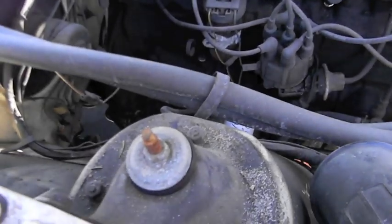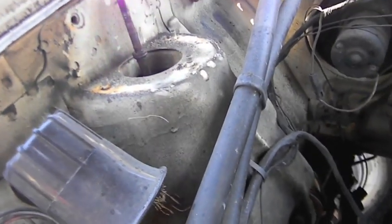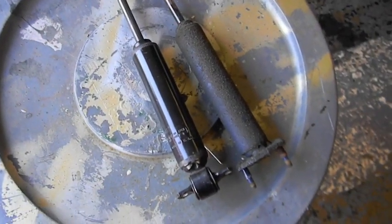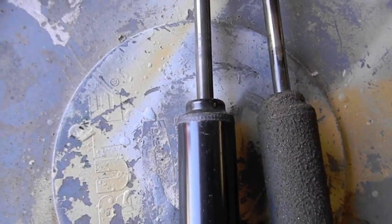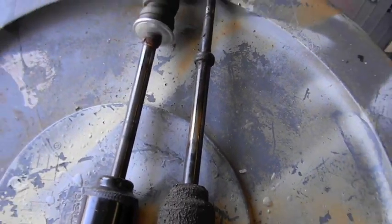It's held on the top, so let's get it out and see what we got. You can see on this side you've got the mount for the shock. I took it off — that was something they added in 1970. In 1968 it was flat, there was a small spring, and the shock actually went from the frame to the lower control arm. After that they put the shock up top and added that mount. Here are the two shocks — you can see the difference in the bottoms. When I line that bottom up with the flat areas and washers, the body of the shock is the same width, so I think we're gonna be good. This shock right here was noisy.